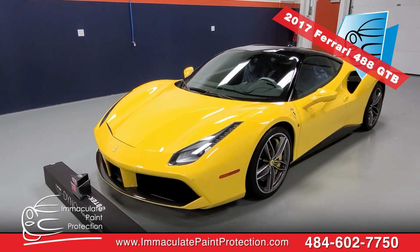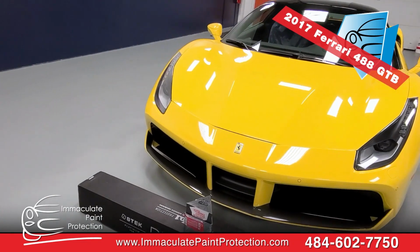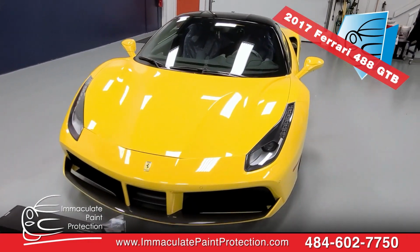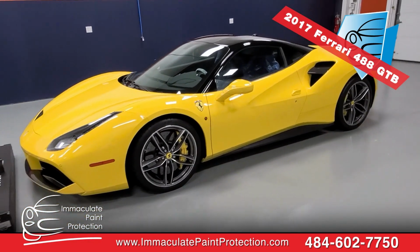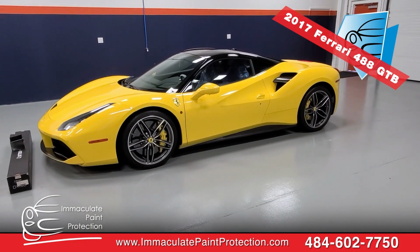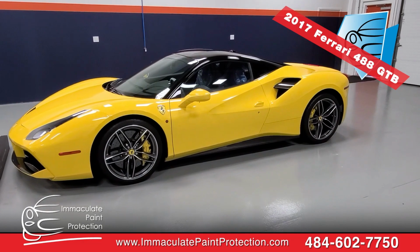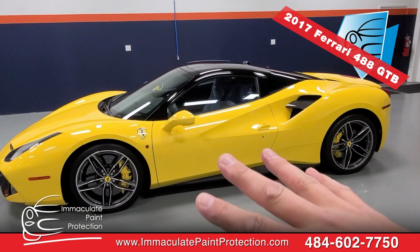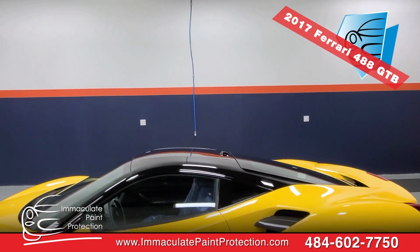So the other thing we did is Gyeon Flash ceramic coating. What's a ceramic coating? A ceramic coating is not going to stop the rock chips, but it's going to help the car stay cleaner longer, and when you do have to wash it, and you will have to wash it, it's going to make it super easy to clean. So we polished the car down, we put the ceramic coating on, and we baked it off. That's why it's so glossy.